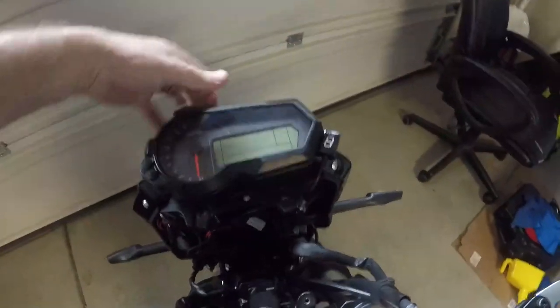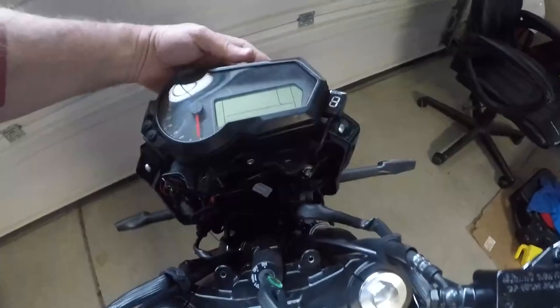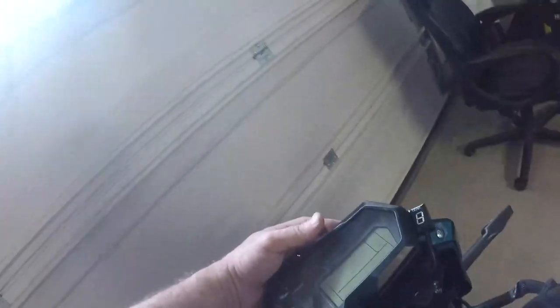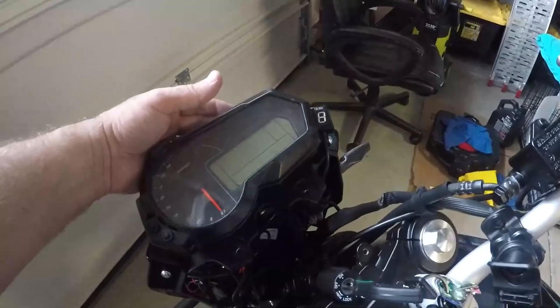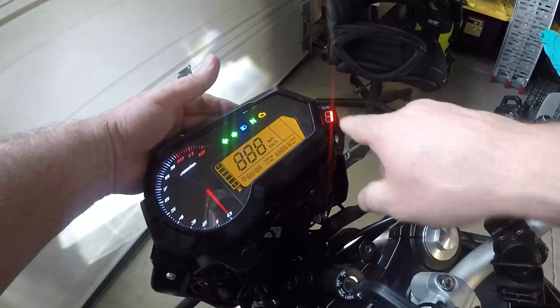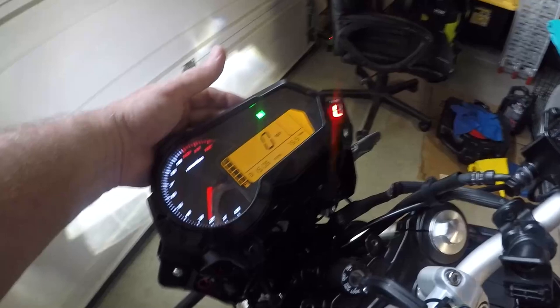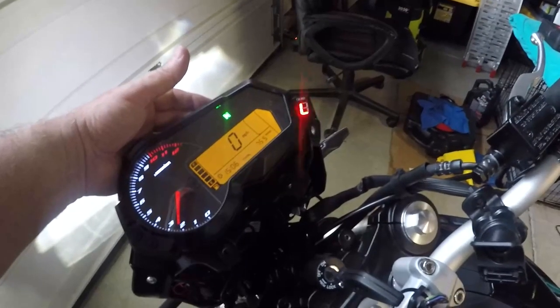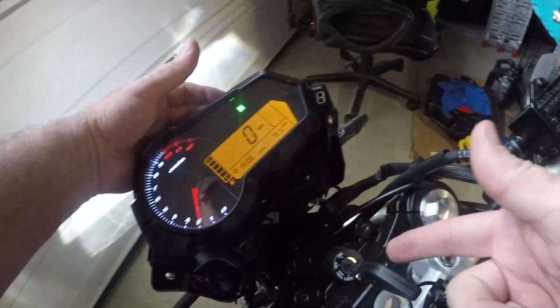So, if we come back up here, the problem I was having earlier was the gear indicator light was always staying L, standing for learning mode. This time around, I tested it just a second ago and undid it for the video, but this time around, it's gonna work. And you'll see that it will shift into one, telling me that I should shift to first gear. Alright, still got power. It's in learning mode. Start this engine. There you go. Now it wants to learn first gear. So the next step's going to be button this up and go teach it.